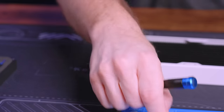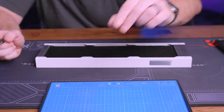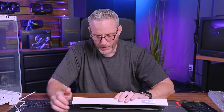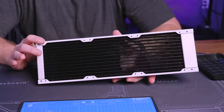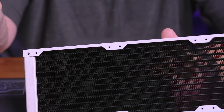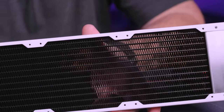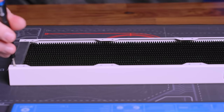I went with white, but if there's too much white going on, I might change it. The idea with this build was to have the case and the build itself look like a level, with the Mega Man character standing on the GPU standing guard. One other important thing to point out: early radiator companies didn't figure this out — computer radiators for water cooling weren't originally specific to computers, they were just radiators adapted for use with PCs. The screws on this radiator are offset so that if you used too long a screw, it would just crush the fins rather than pierce a cooling row and cause a leak. That's important to know, especially for newcomers to water cooling.